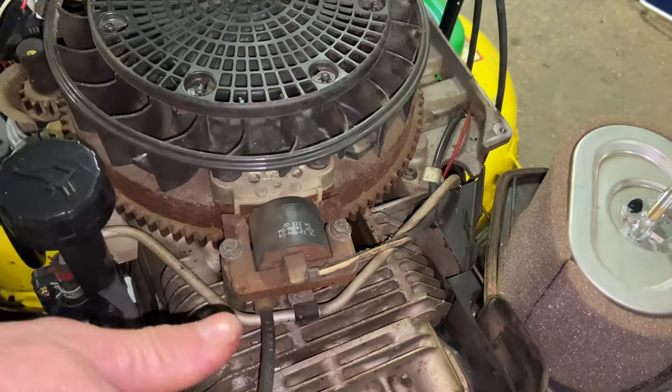I just turned it off because we had sparking down here and you've got to be careful with your voltage regulator. The reason it sparked is because this is a ground from the voltage regulator — it's putting out AC coming in and DC going out — so you have to make sure this is tight. I should have tightened that down. That was arcing a little bit. I hope I didn't do any damage to the voltage regulator. To check, just verify you have over 14 volts coming out when at full throttle. I'm going to tighten this up tight so there won't be any arcing.